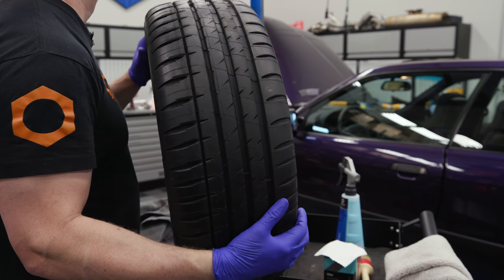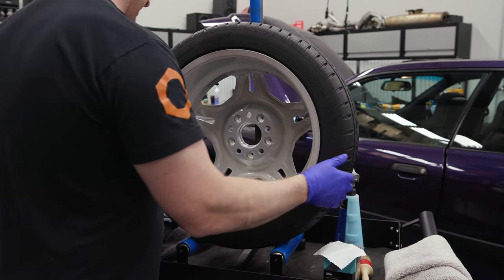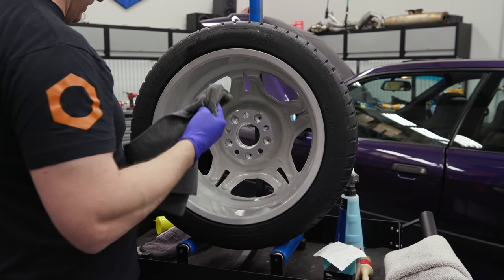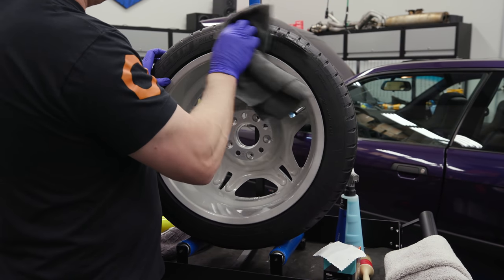There's no reason to coat your wheels and then have problems with potential wheel weight sticking issues. I find it better to just do it after the fact — get all the wheel and tire coating prep done after I get the wheels back from mounting and balancing. It's kind of pointless to clean the inside portion of the tire on the wheel.